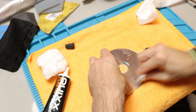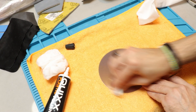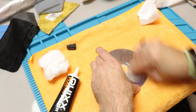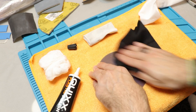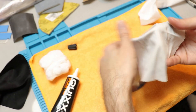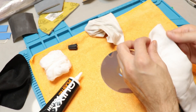In conclusion, can a scratched Blu-ray disc be repaired? I think there is a small chance to repair a scratched Blu-ray disc. Instead of throwing it away right from the start, it is worth a try. Can a Blu-ray be resurfaced? Given the fact that after I sanded off the hard coat I still managed to read the disc, I think there is a possibility to sand off the protective layer, polish the surface and still get it to work. The hand polishing procedure is exhausting and takes hours of work to get the disc to a mirror finish. I think a buffing disc would give the same results in less time with less effort, and I would like to give that a try next time.